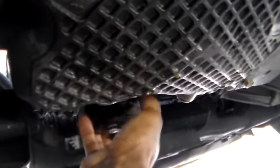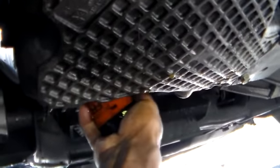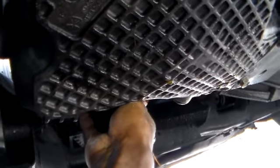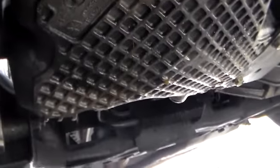The filter — twist it all the way, the rest of the way out. Okay, we got the filter. I'm just going to let it drop down inside the pan. Get ready to install the new filter. Make sure that the little round gasket is not stuck at the top, at the bottom of your oil pan where the filter goes.